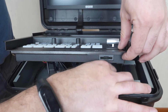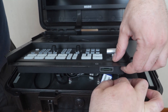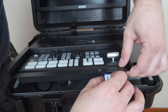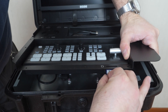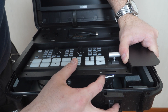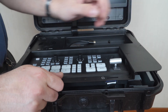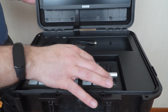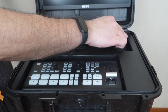Now we put the deck in. And now the most tricky part — we're holding it down but not too much, pulling it a bit back, and gently pushing the SD card adapter back inside. Now we have everything in place, and we can return the screws back to where they belong.